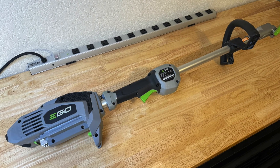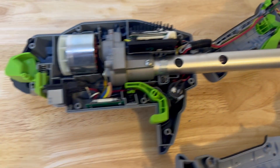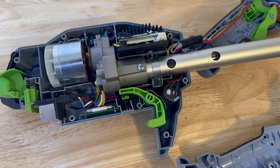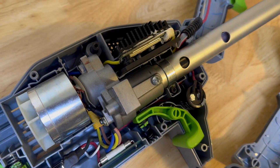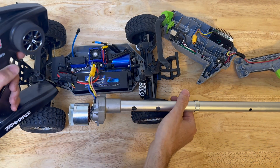So when the multi-head motor quit, I had a feeling I knew what was wrong. That video has lots more details, and they all apply to leaf blowers, and probably weed eaters and other Ego tools too. If you have a dead Ego tool, follow the test procedures in that video — I bet you've got blown MOSFETs. Hopefully this helps you fix your tool. Feel free to post any questions in the comments, and thanks for watching.